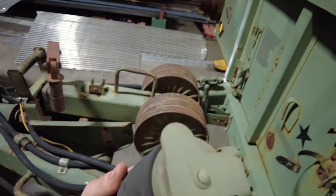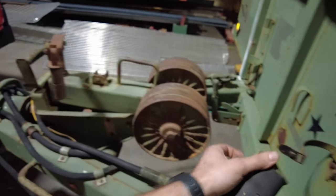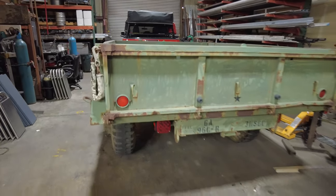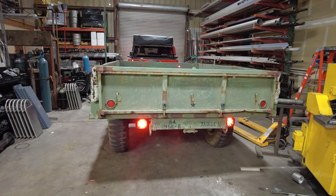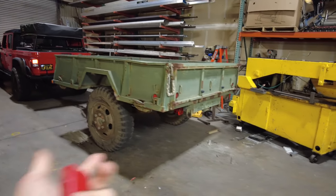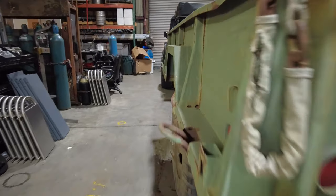This big old thing is the military plug — there are a lot of pins in here. What I went ahead and did, at least for now, is add some lights. We got a side marker light kit, and they actually bolted into the factory location. The original military lights are 24 volts so they wouldn't work, but now we have some really bright LEDs. It was just a kit on Amazon — I'll put a link in the description.